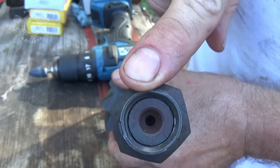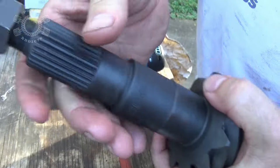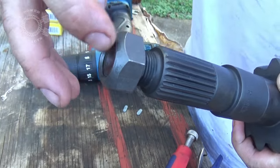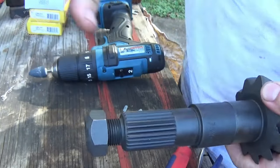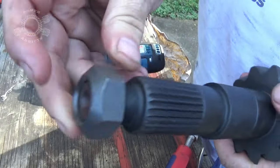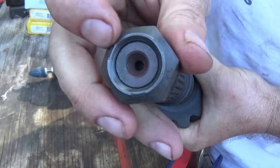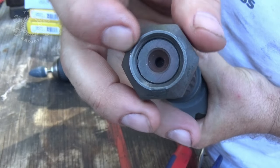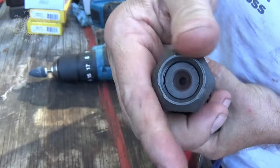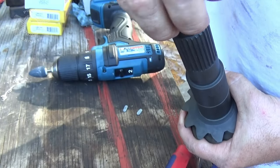So you're going to tighten this sucker up and get your little torque wrench — we're running inch-pounds, and we'll get into those numbers later. You'll be either too tight or too loose, so you add and remove shims until you get it set right. If you take this nut on and off too many times, the locking feature becomes loose and doesn't do its job. So we've got to create a setup nut. Keep this one — the one from the kit — as your permanent nut. I went and bought another one at the local O'Reilly's, part number 7148961, pinion nut for Dana 30.